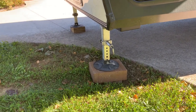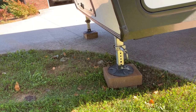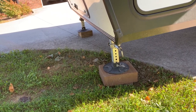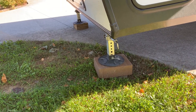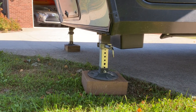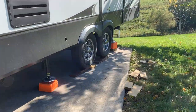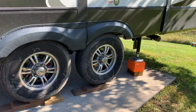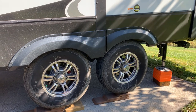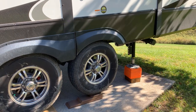You can see it's dropping down all that travel that I ran out — I would have never been able to unhitch this low. The advantage of hitting auto level at that point is that when I press the left and right buttons together when I'm ready to move, it'll take me back to the standard lift height. You can see it's essentially eaten up that entire stroke I had there. Now it's realized I don't have any stroke left in the front, but I have plenty in the rear because it's going to shoot those out and start to lift up the whole left side of the unit.